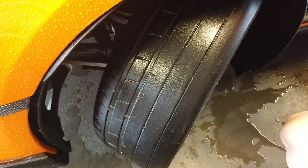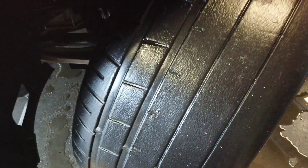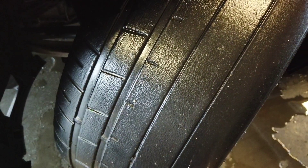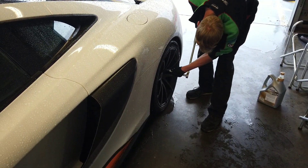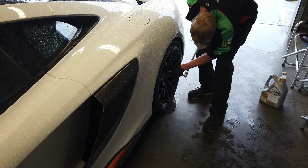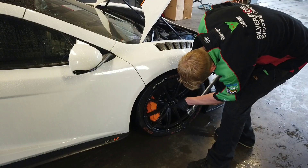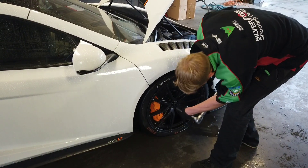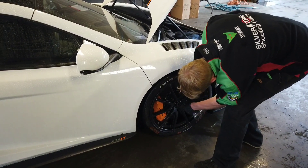Tyres — in this case not much left. Check the track day tyres and make sure the tread is there, and make sure there are no nails in the tread itself. Fairly easy inspection. Lastly, torque your wheel nuts to 130 Nm each and check them throughout the day — it's quite crucial, as they can sometimes come loose during the course of the day, especially if you like to find the kerbs.